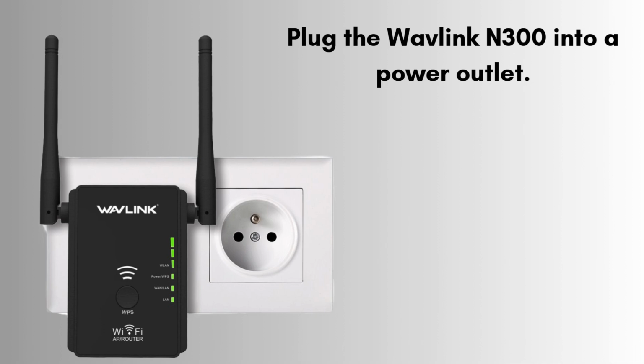Now plug the Wavlink N300 into a power outlet. Wait for it to fully power up. This may take 30 to 60 seconds. You'll see the LED light stabilize, usually the power LED becomes solid.